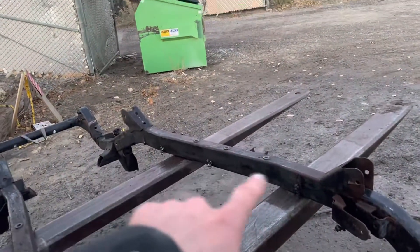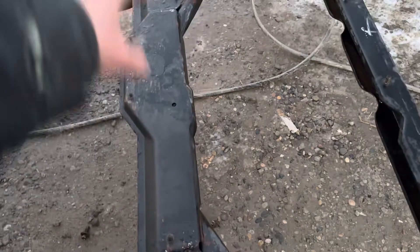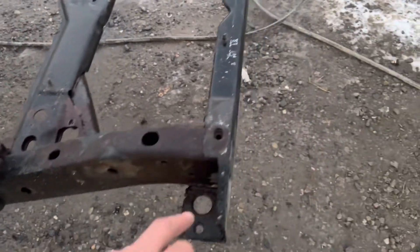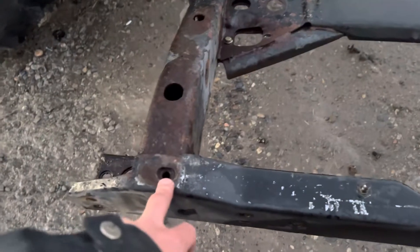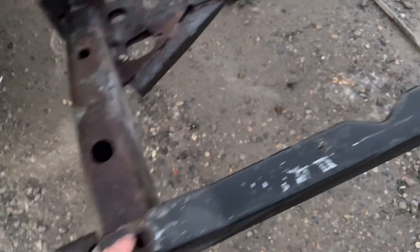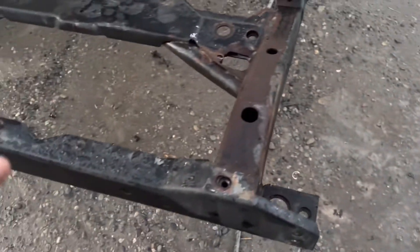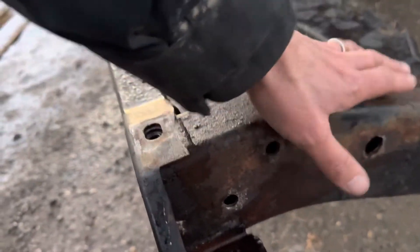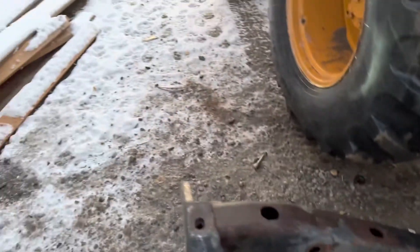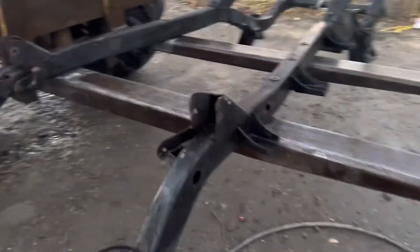The coil spring buckets are super clean on these guys. The mounts for your skid plate are super clean. Then going through your body mount bushings — look at these guys: nice, perfect circles, nothing wallowed out, all the way down. That's what you want to see. Those are your body mounts there to your torque pockets. Here are two more — you can't see those ones unless the frame is obviously out. Then you've got your last ones through here — both nice and clean. Bumper bolts, super important. This Jeep had a hitch on the back of it, and it was pinching here. So bare metal — metal on metal — oxidized metal. That hitch is laying around here somewhere. I always pull everything because you never know what's hidden behind something.